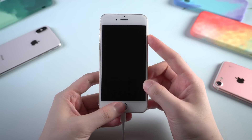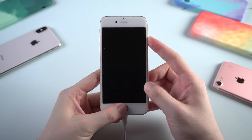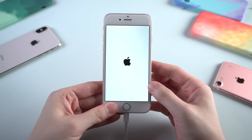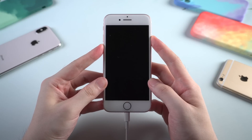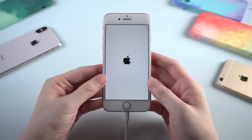So above I've shown you how to enter DFU mode on each kind of iPhone. Next is about how to exit. If you're interested, or you just got stuck in DFU mode accidentally and couldn't get out, this might help. For iPhone 6s and earlier, press and hold the home button and side button at the same time, and release your fingers when you see the Apple logo. For iPhone 7 and 7 Plus, press and hold the volume down and side button at the same time, and release when you see the Apple logo.